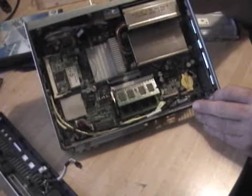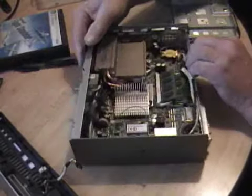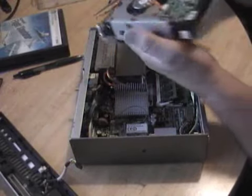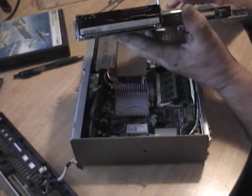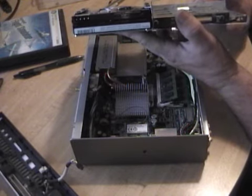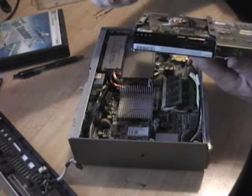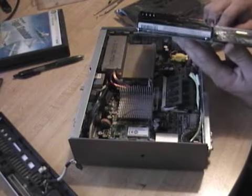The CPU is greased up — the new one is greased up and bolted down. On to the drive cage. It uses a standard 3.5-inch internal hard drive. I guess the newer Revo models use laptop hard drives, but I'm going to replace this with one of the new Western Digital Green drives, since I'm going for a cool and quiet mod.